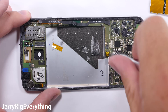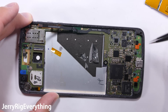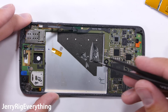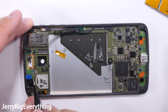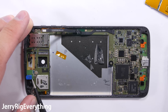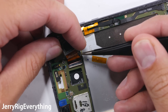There is one more big screw holding the motherboard in place, but surprisingly the motherboard does not want to come out from the back of the frame — I assume it's secured very permanently. The more you bend a motherboard the more you risk cracking the tiny solder joints around the resistors and processors, and I don't want to damage this phone permanently. So we're leaving it in the frame, because there's pretty much nothing here that a common consumer can replace easily without special micro soldering tools and microscopes.